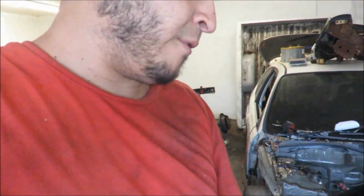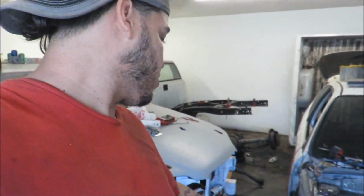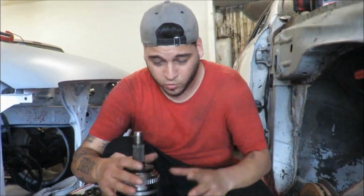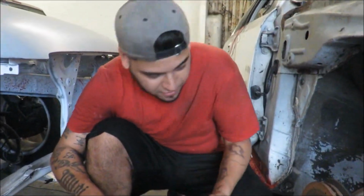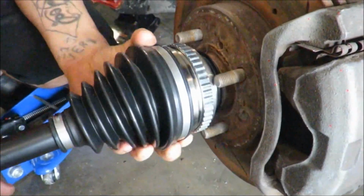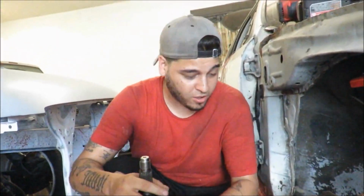Take this wheel off, and I want to see if the axle actually slides into the hub bore of the spindle. If so, then we should know that it should at least fit in there, hopefully. So let's go ahead and get the car up, take this wheel off, and go from there. So we got the car up on a jack. No jack stand because everything else is on jack stands here. Got the wheel off, got the shaft. You take the head of the shaft and stick it in the hole like so. See that? Yeah, brother. So that means this part goes in.